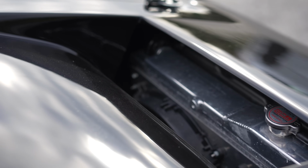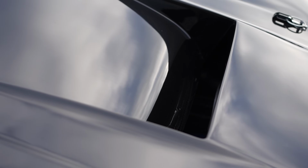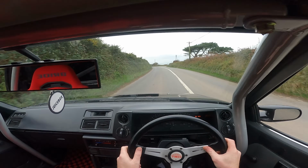So I've ordered a crown wheel and pinion. I just want to get that sorted. But I didn't want to do it in the middle of the summer, because then I wouldn't have got the car to any events or anything. So I've kind of just lived with it. I've also learned that having an Exedy Hypercarbon single clutch is probably not the best thing for dailying and stuff. I'm probably talking through my arse, but I looked into it and the carbon clutches cool down and they start slipping. I need to get a clutch and flywheel also.